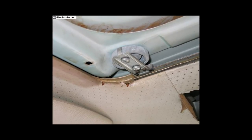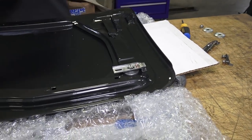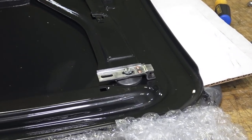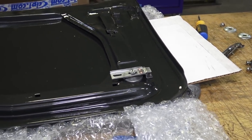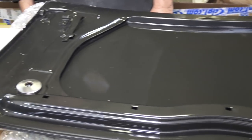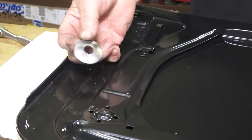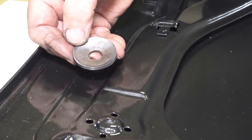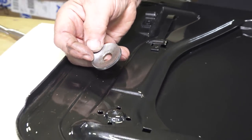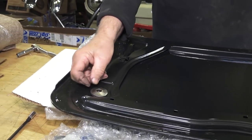In this next section, these are the front risers — a circular nut slider. There are two different kinds: early and later styles. We had the sliders but did not have the circular nut to adjust the height. I don't know why — I was kind of new to this. There are two different styles, so we improvised: we grabbed washers, like one off a shock absorber, and we stack some washers to give the height for this center piece.